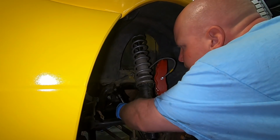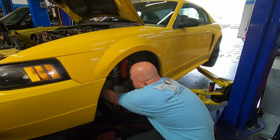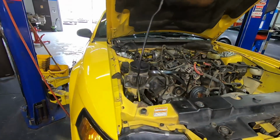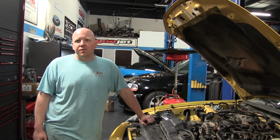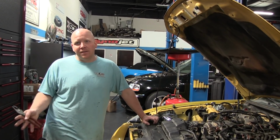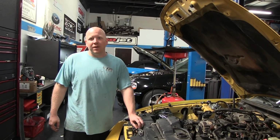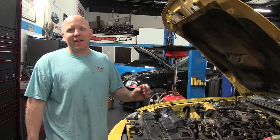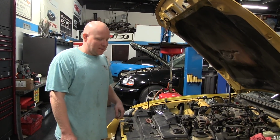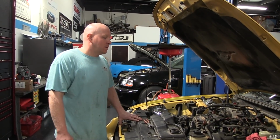Unfortunately, there's not a single kit with everything you need to do the swap. Connor says he's seen this project frustrate a lot of guys, and it's rarely the big things that end up biting them. It's all the little problems that pile up into one big headache. Fittings for power steering, air conditioner lines, stuff like that. They make the brackets and the AC pumps and the power steering pumps to retrofit to the Coyote motor, but a lot of times they don't give you the little details that you need to actually make it work. So that's probably the biggest thing that somebody trying to do this in their garage doesn't have access to. It would take longer to make it happen.